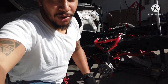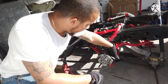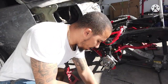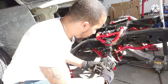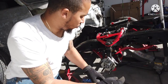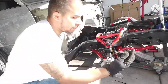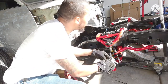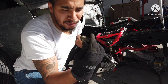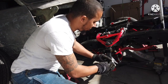I can show you some of the process. I did take the hub off — it's just three bolts in the back. I took those three bolts out, pulled the hub, and slid in all the new studs. I'm going to be able to install them today. Take the wheel installer tool, slide it on there, take the lug nut — I had some extras from the blazer, though a lot of them were stripped. This one's working pretty good. Thread it on by hand to get it started.